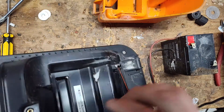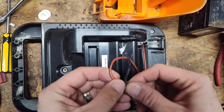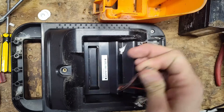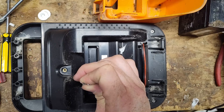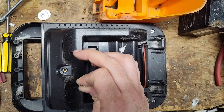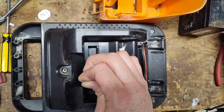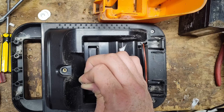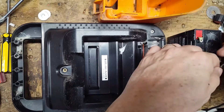One other thing we can try — we'll lay the leads face down and hold them together, metal on metal. What this does is reset the unit. These are software-driven units with a lot going on, and this will discharge any residual voltage stored up in the capacitors, the board, or whatever else is inside. That's usually long enough. The battery is good — let's hook their battery back to it again.